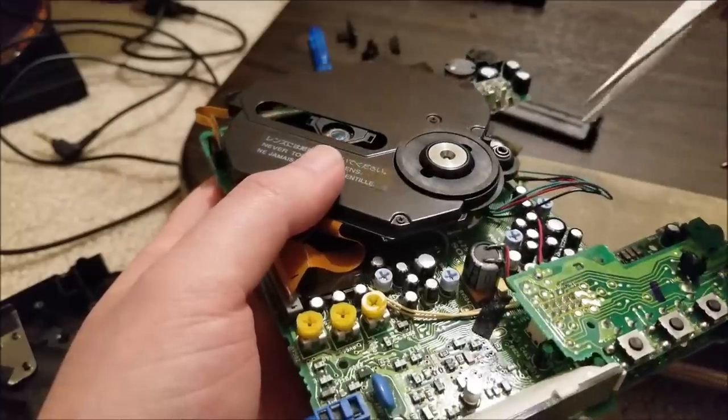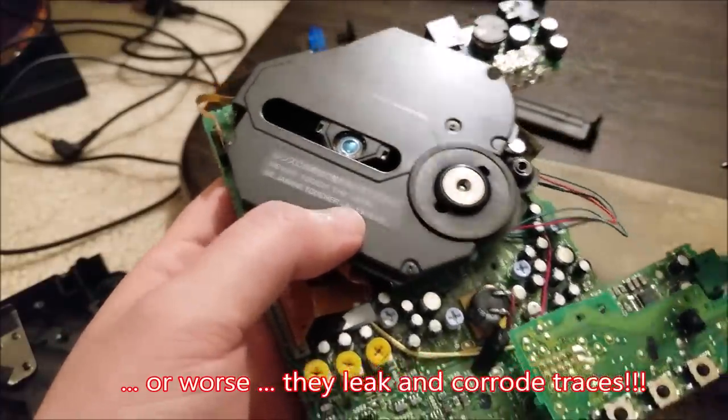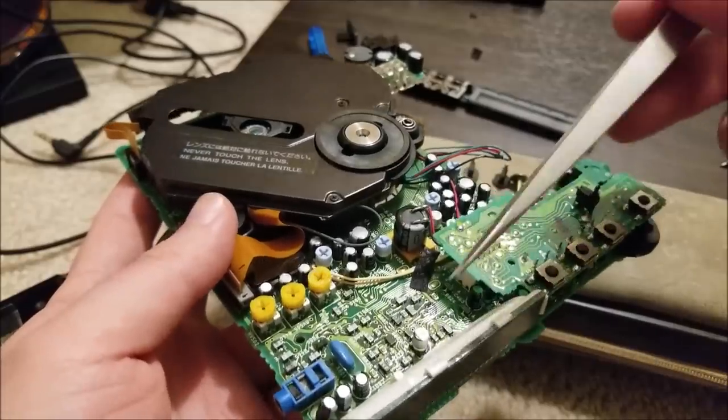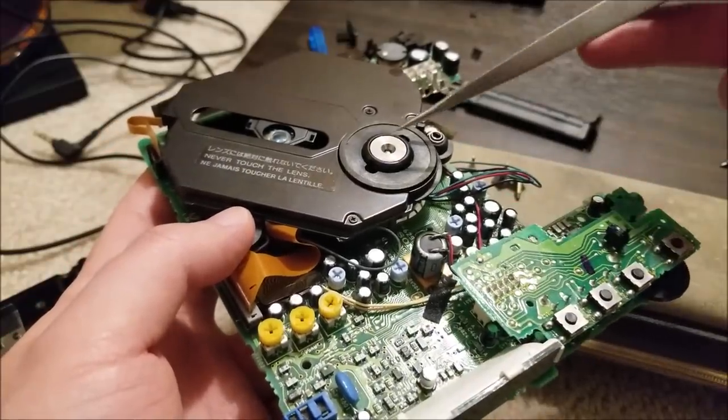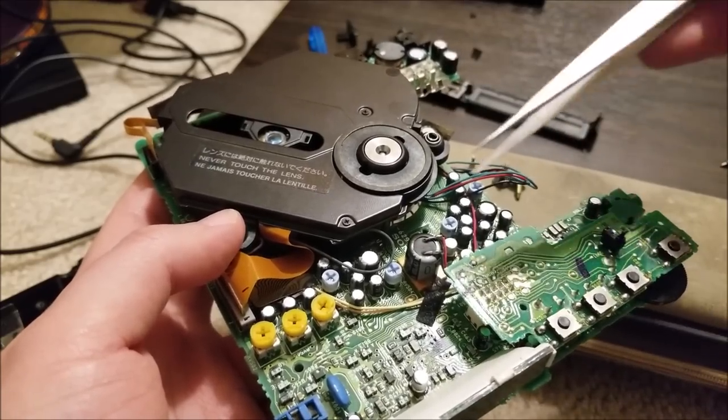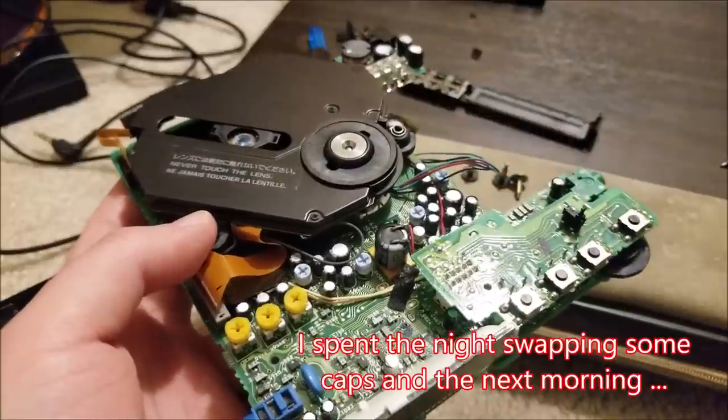While it's seeking, I can hear it, but the entire display flickers. Another common issue with these old units is the electrolytic capacitors — once they age, the electrolyte dries up and they start to fail. I'm going to replace the largest ones. I have a feeling it's browning out on the laser and motors, just not having enough power. Swapping these caps out should help.